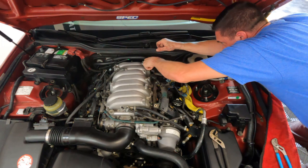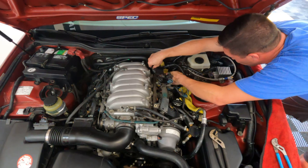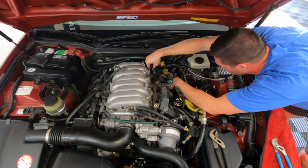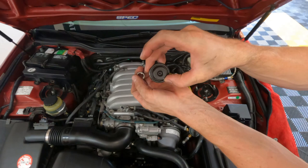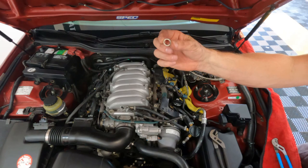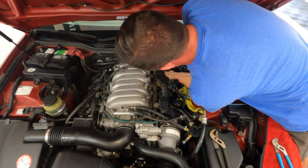Now you should be able to unscrew this damper and pull it straight off the rail. Watch out because there are a couple washers — there's a star washer on the top and then a different washer on the bottom part, and you don't want to lose them if you don't have replacements. Here's the damper, and as you can see there should be a screw in the top but there isn't — somebody put in a flathead and it came out. This is the washer that goes on the bottom of the banjo fitting, in between the banjo and the rail.